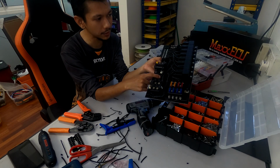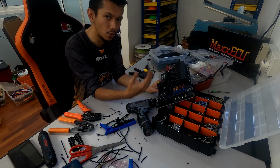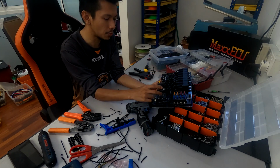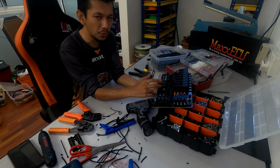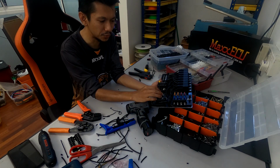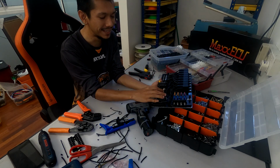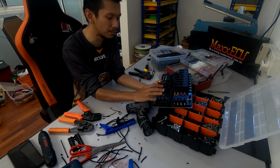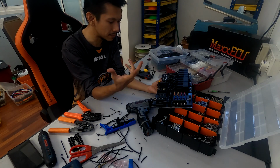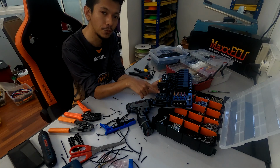So that one, I want to make sure that the nitrous solenoid activates at the same time as the fuel solenoid. You don't want one of the relays to get spoiled or one fuse to burn and only one is activating. If only fuel is activating, that is no worries. But if just the nitrous activates without the extra fuel solenoid activating, yeah, you're gonna run extremely lean and you're going to blow your motor, or the piston ring is gonna start to close the gap and crack those pistons up. The other two is for the fuel pump.